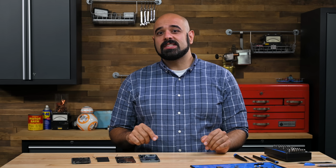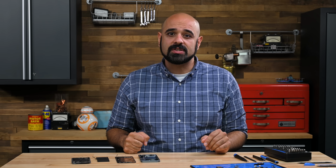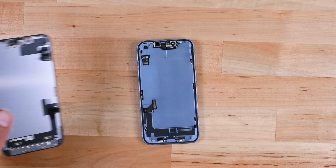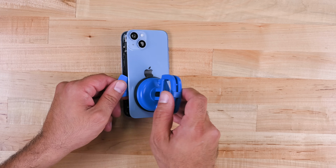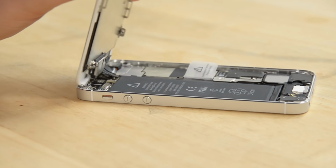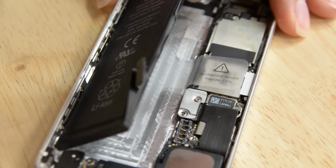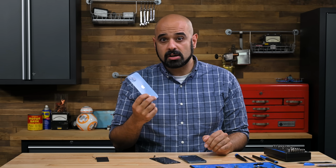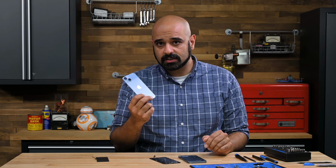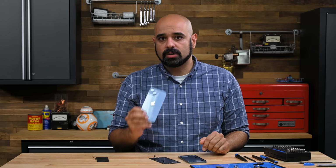Apple has made a huge design change to its lineup that goes well beyond the incremental changes that we've seen in previous models. The ability to remove both the screen and back panel addresses one of the main repairability challenges with the iPhone. Since the 5, they've used the design optimized for the 2 most common Apple Store repairs, the battery and screen. The disadvantage of the front-optimized design, of course, is that it's harder to replace the back glass panel. This new design solves that problem, but it wasn't easy.